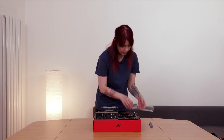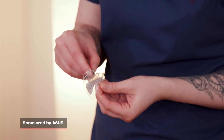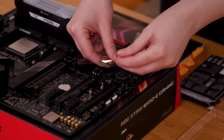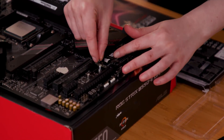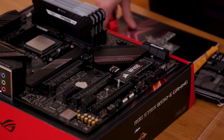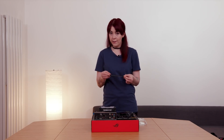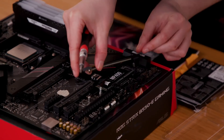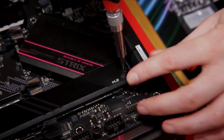And I'll keep the PCIe 4 slot free for if I get a faster drive in the future. Taking out the SSD, I need to get one of these hexagonal screws out to hold it down. I've just spotted in the manual that this M.2 cover is actually a heat sink — it draws heat away from the NVMe like a traditional heat sink. It's got thermal paste on the bottom, so I'll remove the plastic before putting it back down. And that is the SSD done.